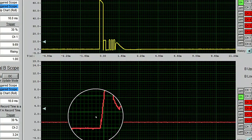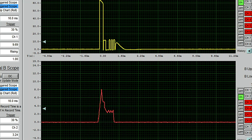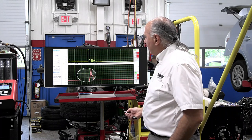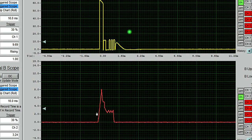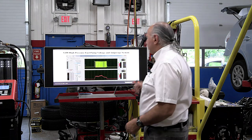Now if we didn't use the high voltage, that amperage would be higher — so there's another reason to use high voltage: keep the current lower. You can see how we modulate right here, pulling roughly about three amps pulsing. So about three amps is going to keep it open. And this is how we measure the pulse width — from here to here on voltage, or on amperage from here to there. That is the amount of time the injector is open to actually spray fuel in.